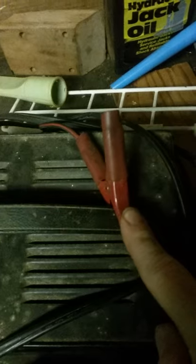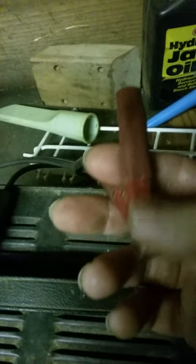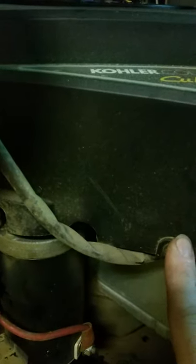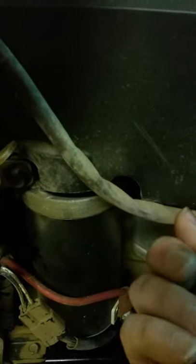What happened — I believe this one had corroded or faded and looked black, and I think I stuck the wrong end on there by mistake, getting in a hurry to crank the lawnmower. I think that's what shorted it out. Since then, we got some red paint and painted this terminal nice and red. It had mold on it and looked almost the same color as the negative terminal, which it doesn't now. The voltage regulator — that little thing was about 50 bucks, right up underneath there under the cover.